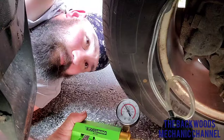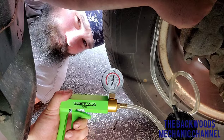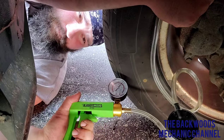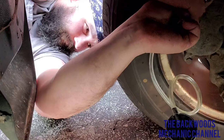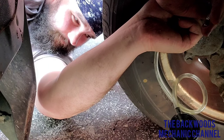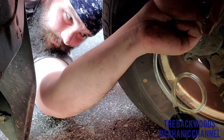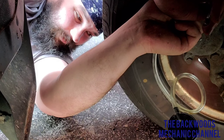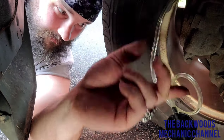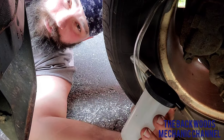Cut your wheels and move over to the passenger side and do it again. Now we're on the passenger side — we're holding pressure. Lay that gauge down where you can see it and crack open the bleeder. As it slowly goes down to zero I will shut the bleeder back off. I've got these hoses tied up here so they will not interfere and go down into the pump — if it goes down into the pump it could ruin it. You do the exact same thing on this side as you did on the driver's side, until you start seeing that clear fluid come out, then make your way to the back.